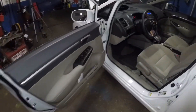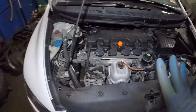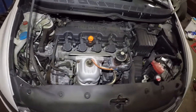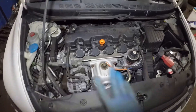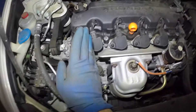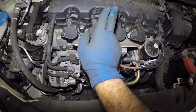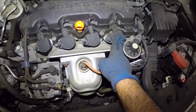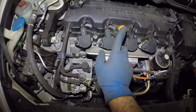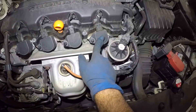I'm going to shut this car down and we're going to go under the hood. So now you would be wondering: which is cylinder number 3? Usually on these Hondas, a 4-cylinder inline, the belt is here so it starts on this side. Cylinder 1, cylinder 2, cylinder 3, cylinder 4. So if you have code P0301, this is the one you're looking at — P0302, P0303, P0304.